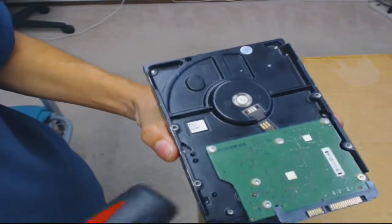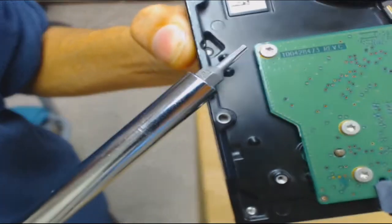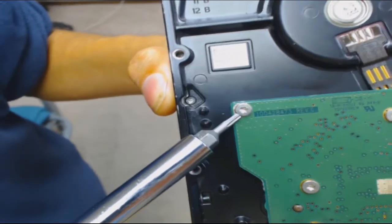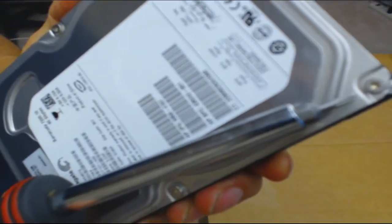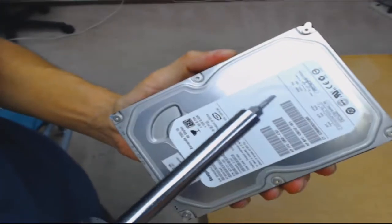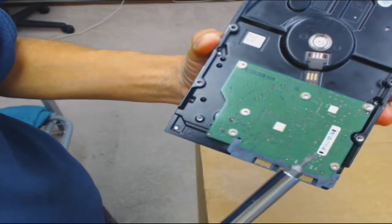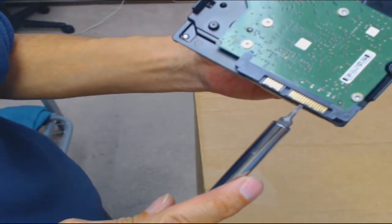What we're going to do is take this circuit board off. These are Torx screws — a lot of mechanical hard drives, especially the desktop ones, are held on by Torx screws. They're shaped like a star. The screws hold down the cover, and underneath the cover are the heads and the platters, but we're not going to mess with that. You do not need a clean room for this tip. All you're going to do is take off this circuit board. Every desktop and laptop mechanical hard drive has a circuit board.